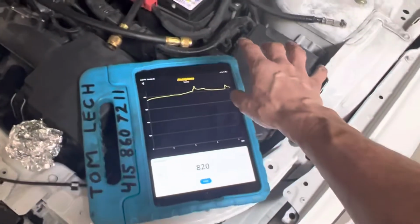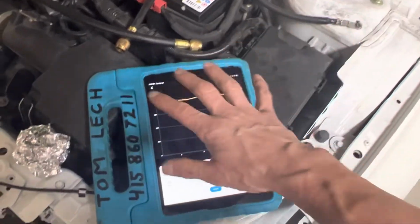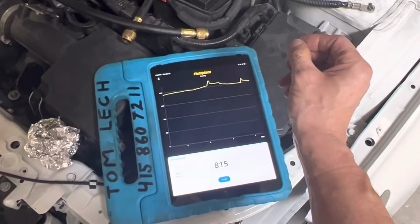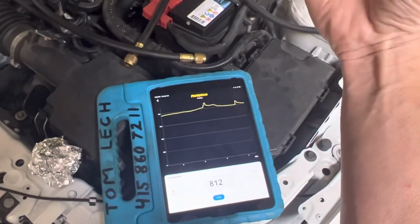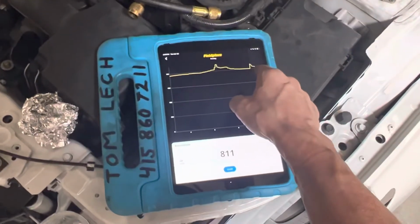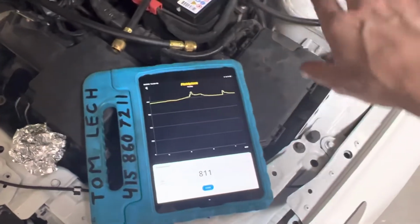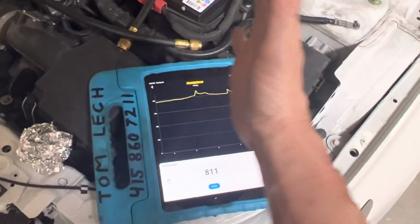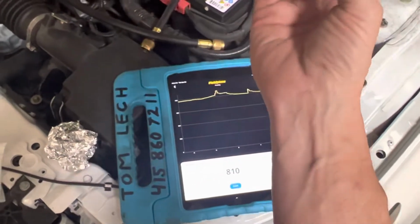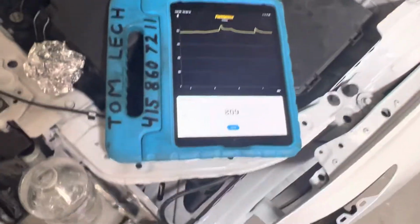If you think of bubbling water, just before it boils, you see those little bubbles at the bottom of your pot. Then you have the heat on, and one bubble bursts out and explodes into steam. That's pressure into the atmosphere. The same thing is happening here. On the surface of the metal where the oil is, there's moisture trapped in the oil and in the pores, and it's coming to the surface and bursting out, popping as a steam bubble. And this is what you're measuring.